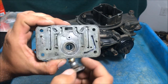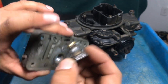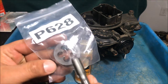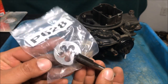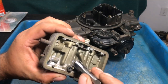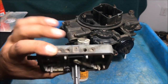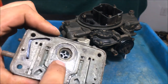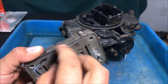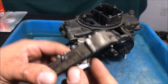That metering block from the other video that was stripped out — I was able to save it 100%. The threads on the power valve strip before the threads on the metering block, so I did it off camera because it was very difficult to get started. I got both of these for about $12 or $13 off eBay, used plenty of oil, and it took about 15 minutes to carefully get them started. Once started, it threaded out fine — no thread damage at all.